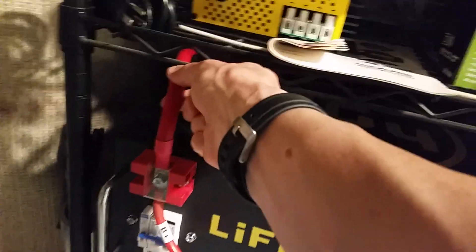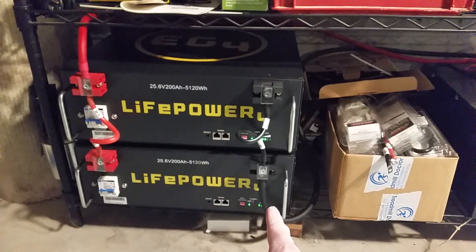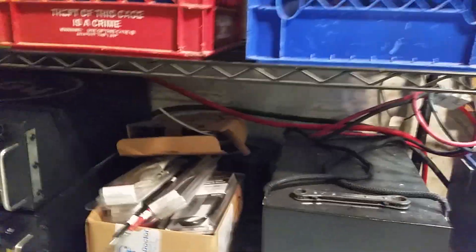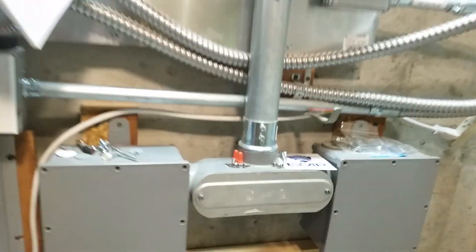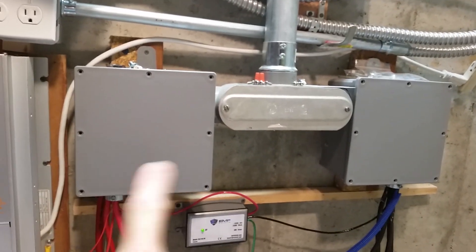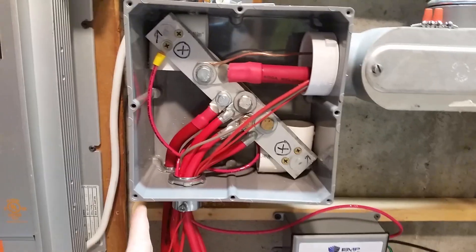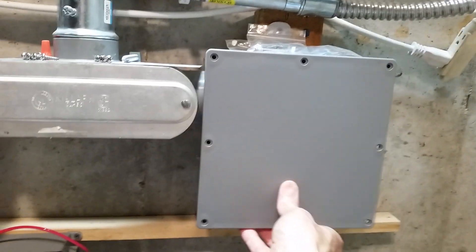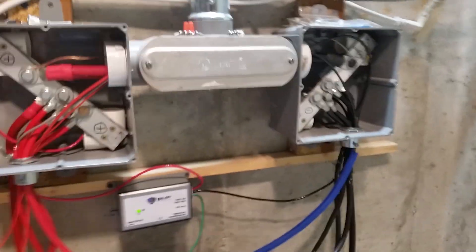I ordered 10 feet of 2-gauge wire, which is what we put together in the other video. Here's the black one — I got them alternated, one comes in down here and one comes in down here, to even out the power flow and the current. It's not the cleanest install but it works. They run all the way over here to our bus bar boxes — positive and negative. The battery cable runs in here to the positive bus bar, and over here this one runs into the negative bus bar, and then they connect up to our system.